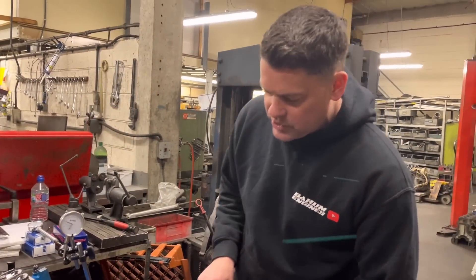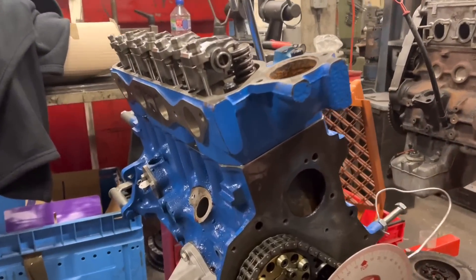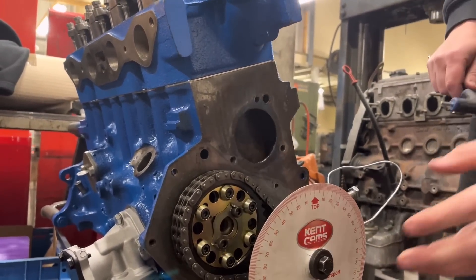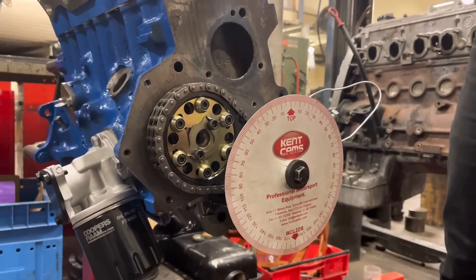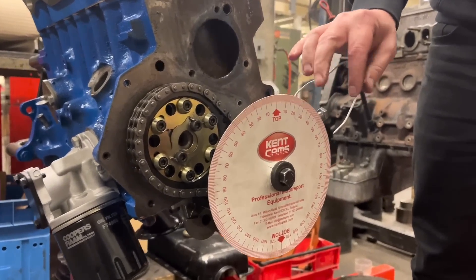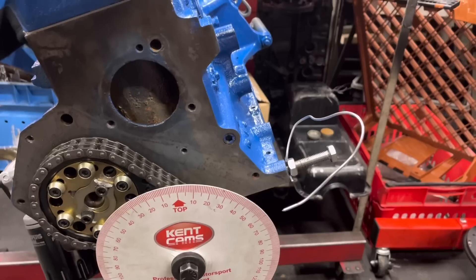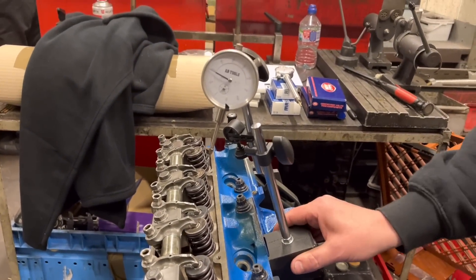We've assembled it all. First thing we do is slacken all these bolts off and just tighten one — I've marked the one there with the black marker, which we're just nipping up, the rest are all slack, and I'll tell you why that is in a minute. We put our disc on and do this nut up here so that is securely fixed, and then we attach a marker here with a point on the end — you can see it's just a bit of welding wire that we've adapted — to mark true TDC. We've also got our DTI gauge here which, being a cast block, we can magnetise onto that, and that is to check the lift on the valve in a minute.